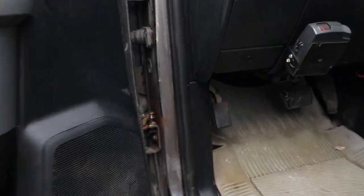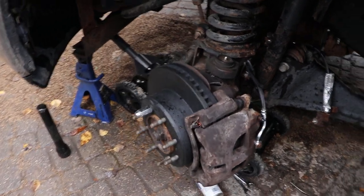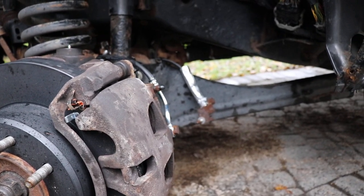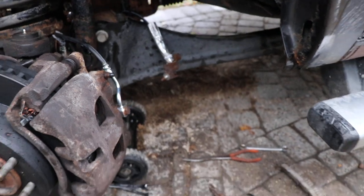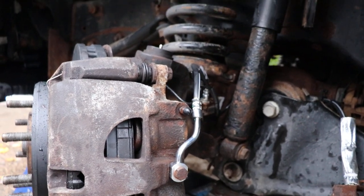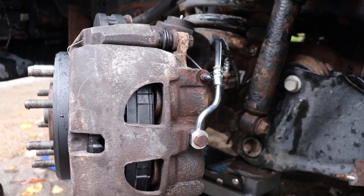That creaking — that pin on the top of the door stop is ready to pop out of there. Other than that, I did the brake job on the front and back as part of a safety inspection. The reason I'm doing the lines is that one brake pad was half the thickness of the other side. The shop figured this line was collapsed — they had to loosen the bolt to release the brakes. You could see that everything had been running hot and it wasn't working right on this side.